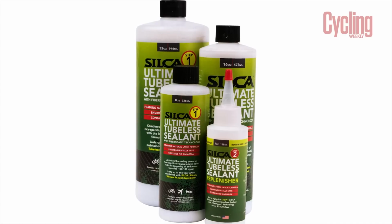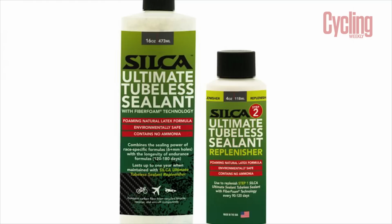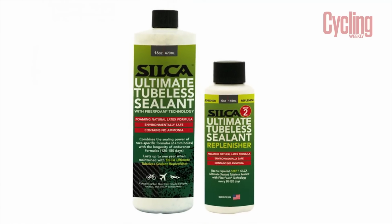And obviously the benefits of carbon fibre mean that it's a lot stiffer than fiberglass, and where you've got much bigger chunks, in theory, and what Silca say, is that you can then seal that at a higher pressure. Now, for roadies who have struggled with tubeless sealant in the past, this could be the answer to their dreams, because if you can run it at a higher pressure and seal holes of up to 6mm, which is what Silca are claiming, then this could be an absolute game changer compared to the other sealants that are out there.